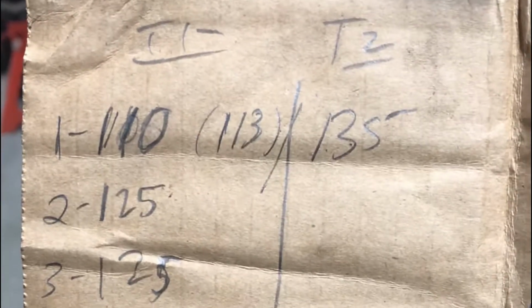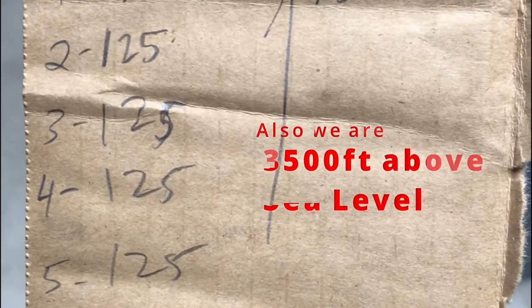It's a little low. Here you have the numbers from the compression tests. As you can see, they're actually pretty consistent. Consistently low, but workable. This could be for a few reasons. Number one, the engine's been sitting for a while, hasn't been cranked, hasn't been started, so it's cold. Also, the lifters might be bled down a bit. And the third reason is that it's got smogger heads on it. They're from the 70s, although I would expect to see slightly higher compression.